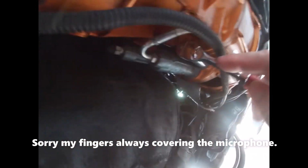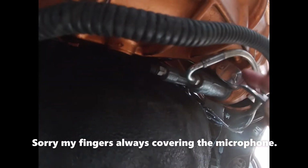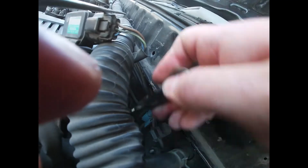Tightening up the clutch slave. And I'm gonna go ahead and go in the car to see what the clutch pedal feels like. Then I went ahead and torqued this one to like 18 pounds. 12 millimeter bolts around the slave cylinder housing. Pretty sure I don't need to tell any of you guys, but for those that don't know, here you go. This wrench right here is a lifesaver.